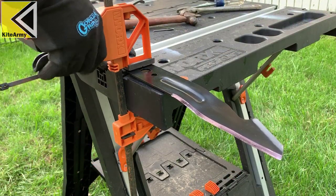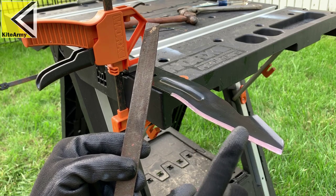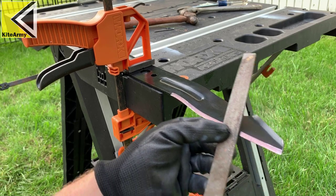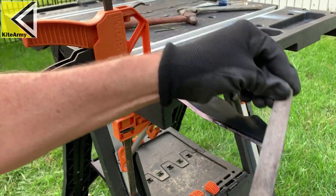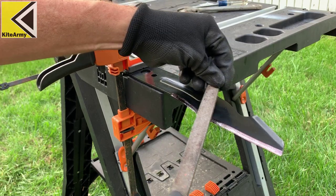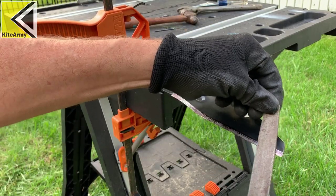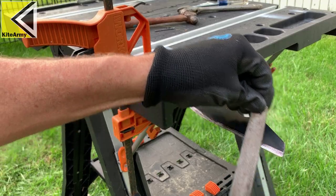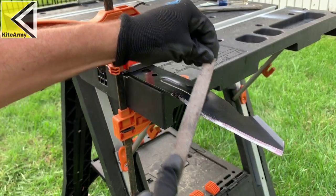The next thing you want to do is secure your blade to the table — make sure it's nice and tight, really firm. Take a good hard look at the blade and notice the angle of the current edge; use that as a guide for sharpening. You just go along that edge trying to keep that same exact angle. The blade has a little bit of a curve, so follow that curve with your file and try to keep it at the same angle through the whole blade. The Sharpie shows you where you've filed — go along the whole edge taking out all burrs and nicks.